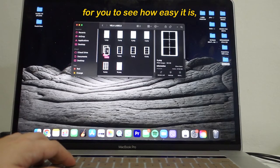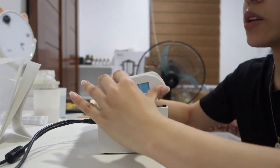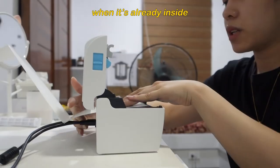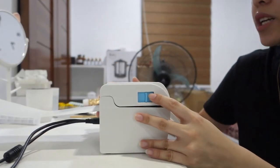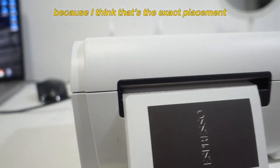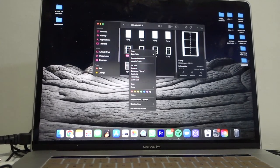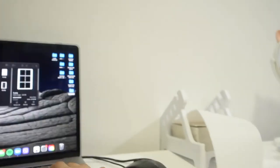Let me show you how easy printing is — I'll put the paper in the printer. Just open it from the side, push it forward, then open the lid. Insert the paper into the green slot. Make sure your finger doesn't get caught because it'll clamp down. Make sure it's straight. Once it grips and you can see the cut mark aligning, it's okay. Sometimes it still misaligns, but just keep trying. Double-click your picture, press Control+P, go to the label preset you made, and print.